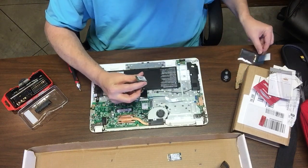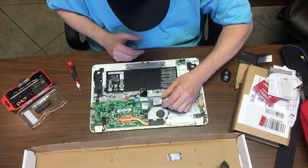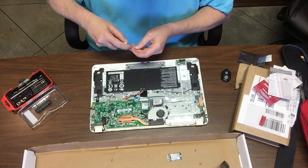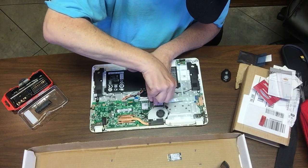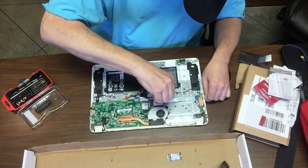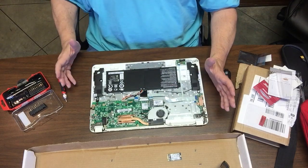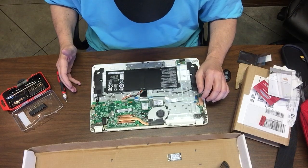I'm pretty amazed at how tiny it is. I'm going to slide the new drive inside here, just like that — good fit. Get it down. This part might be a little tricky. Maybe that's why it has that extra wide head. Push that down, being careful it might touch the board — just touch the label. Then just tighten it down to the point that it's finger tight. The new SSD looks seated okay, everything looks good.